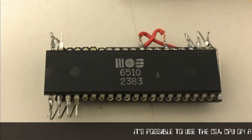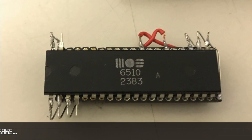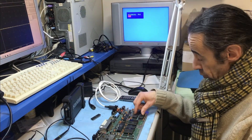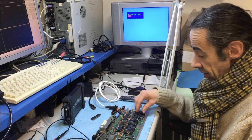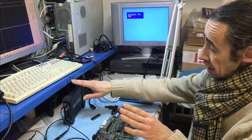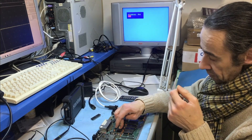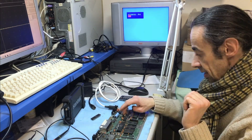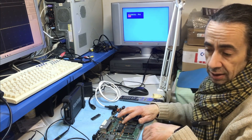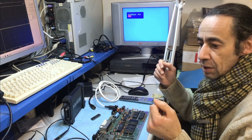I also built an adapter for the C6510 from the C64 for troubleshooting. A little recap: I changed the CPU with the FrankenCPU and removed and tested all the RAM. Still the Plus 4 gives a black screen. I checked with the oscilloscope and the CPU seems okay, but the TED has very strange signals. I can't do anything other than wait for the TED I ordered — and with the magic of editing, you'll see the result in just a few seconds. In reality I had to wait a couple of weeks.